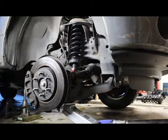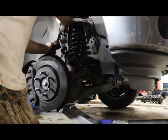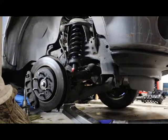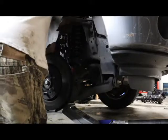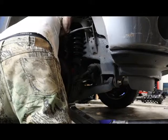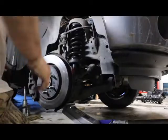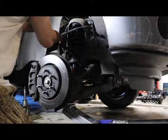We need upper control arm nut. I'm gonna do the same thing here. Now, if you look at these, when you're pulling them, at least on the 2013, I imagine that a lot of them are the same. You can see there's a red Loctite all over. Yeah, and always make sure you got your nut started. This set is what I used on the top side.